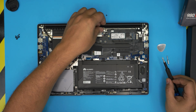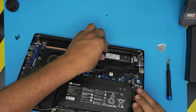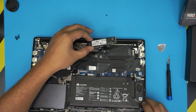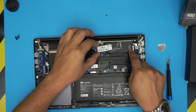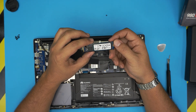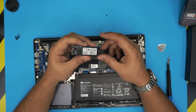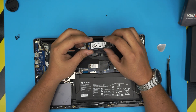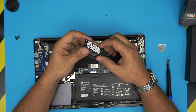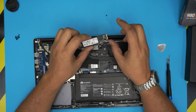Now you can lift it up slowly about five to ten degrees — you don't want to yank it up too much. I'm just pulling up this much and then pulling it back towards the fan, and that's it. You don't want to yank it up otherwise you're going to crack the connector or crack the SSD drive. This is a Toshiba one — it's okay but not the best. I'd recommend swapping it for a Samsung brand. Once you replace the SSD, you won't have any operating system — I have videos on how to create a Windows 10 USB boot drive and how to install Windows 10.